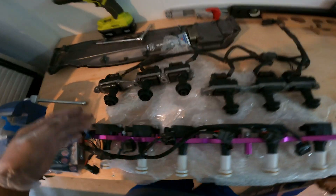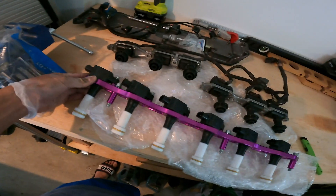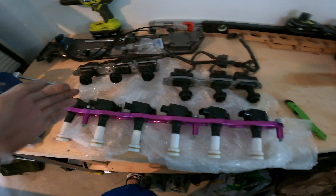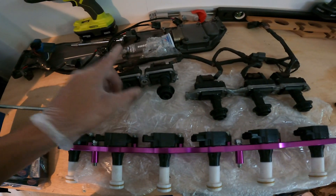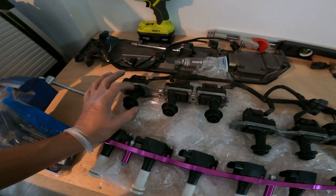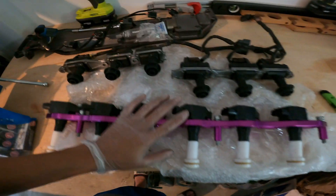Comparison-wise, these are the R35 coils — the new ones — and these are the old ones. A lot of problems with these old ones causing misfires. They're really dirty — I mean, you gotta think about it, they're 30 years old. The spark tends to hit the coil pack bracket rather than coming out through the tip, and that's how you get misfires. So we're going to upgrade with these and put them on right now.